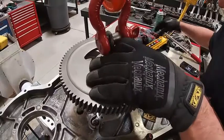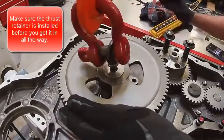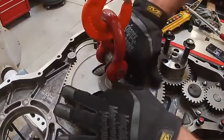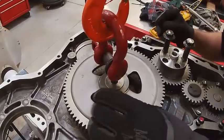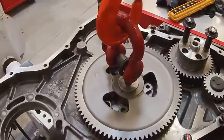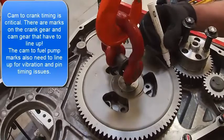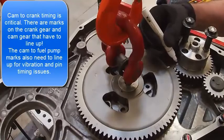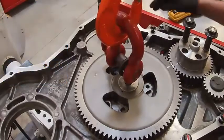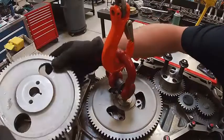My retainer's down here — it's already on there, just have to put the bolts in it. Make sure this is in the right spot — my retainer. There you can see the zero to zero. There's another zero over here that will go to my fuel pump. There and there is where the teeth line up, so the engine is timed. The reason I can tell is there's two zeros there and one there.